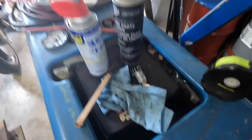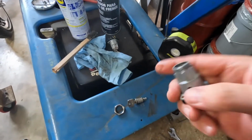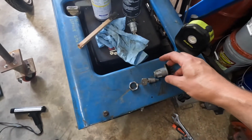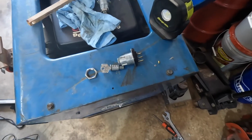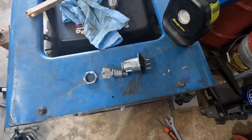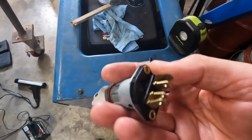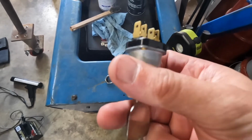It's because you can take the tumblers out, so you can just pull the key assembly out by pushing in on that little hole. There's a little pin there that holds it in. Since it's dirty, nasty, probably original, had some voltage drop for a little bit until I wiggled the key. I have this MGO replacement. This was on a BSA that I have been working on.